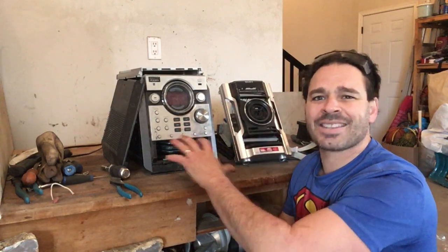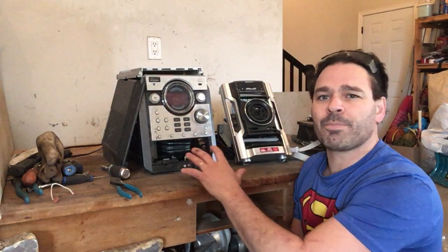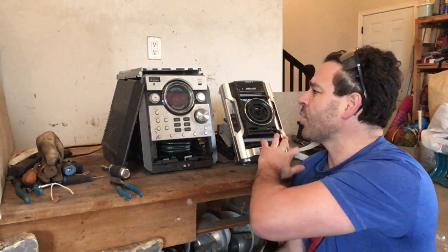There's going to be a really nice heavy transformer in there that's loaded with number 2 copper. There's going to be some aluminum heat sinks, other aluminum pieces, lots of tin and brass and other scrappable items. So what I'm going to do today is take one apart, show you how to identify the material, and more importantly maximize your profit and divert as much of this away from the landfill as possible.